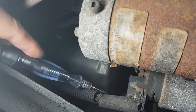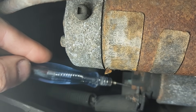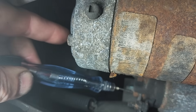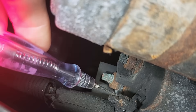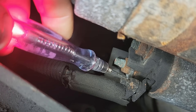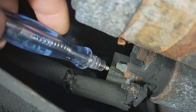So we're chasing our heavy gauge circuit. The reason I went to the post is I wanted to see what the starter motor is seeing. The next step is going to the nut, because we could have our problem right here. Go ahead and crank it again, Caleb. Okay — it's bad right there on the nut as well. Now I'm going to go to the eyelet, because we could have a problem between the eyelet and the nut. I'm on the eyelet now. Crank it. See how the eyelet stays lit. Crank it again. It's lit on the eyelet and never shuts off — that means our voltage drop is right here, literally right here.